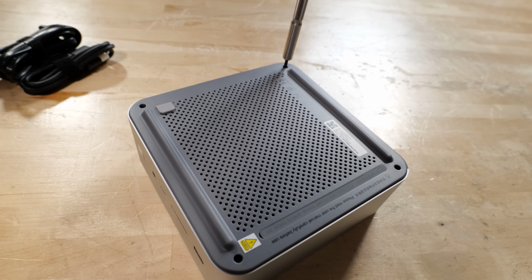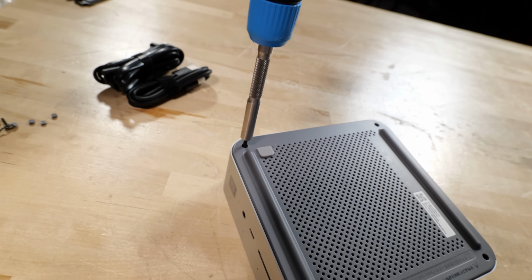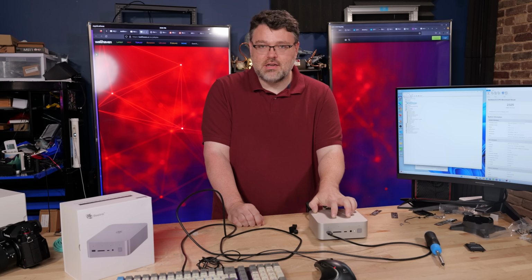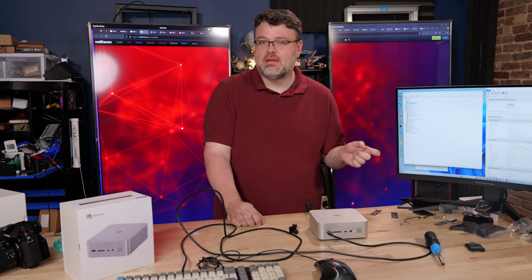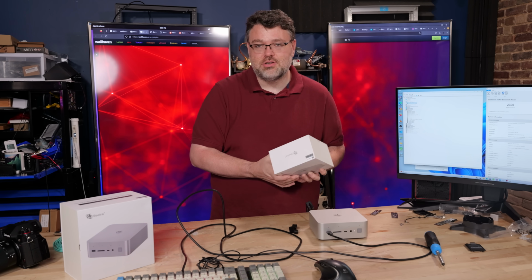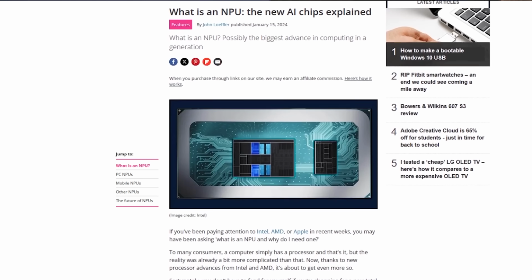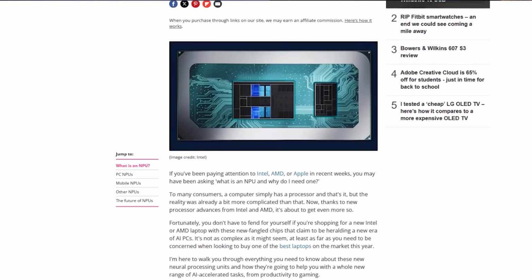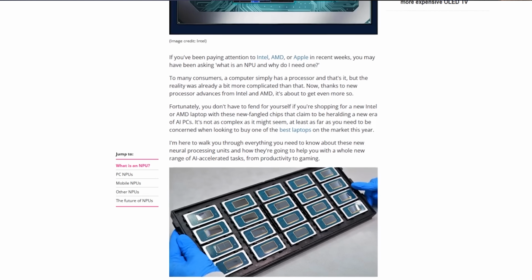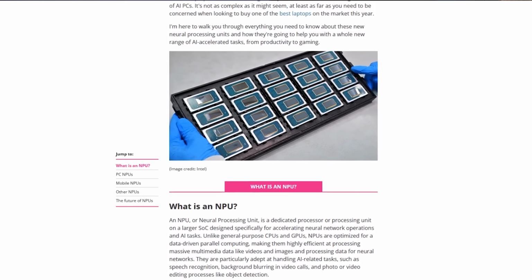not really super useful. And keep in mind, this thing running full tilt can use north of 100 watts out of that CPU because you're talking about Arc graphics, the NPU, and everything else. Nevertheless, this thing is going to find a permanent place on my shelf because it is a great exemplar of the Meteor Lake architecture, including its NPU. One key competitive differentiator against the 8845HS could be the NPU if there was a killer application for it, because Intel and AMD have gone different directions in how they're implementing AI on their products. NPUs really make sense on devices that are powered from a battery because an NPU is designed to offer GPU-like compute at ultra-low power, specifically customized to the type of compute a large language model or other AI-type processing would be doing.